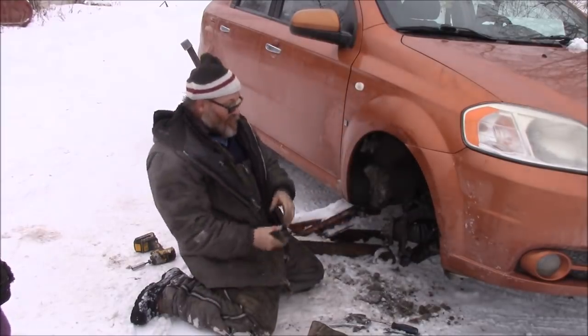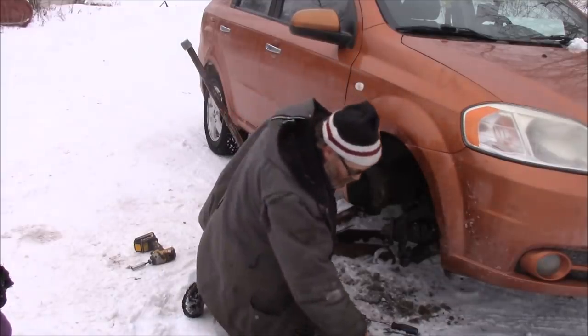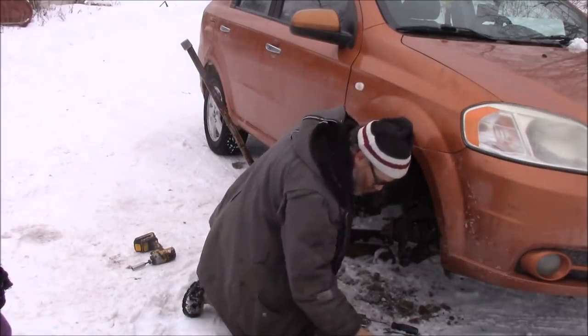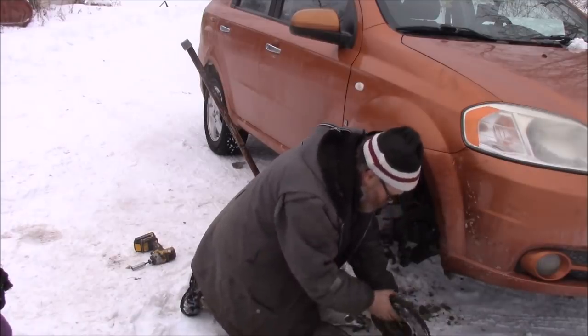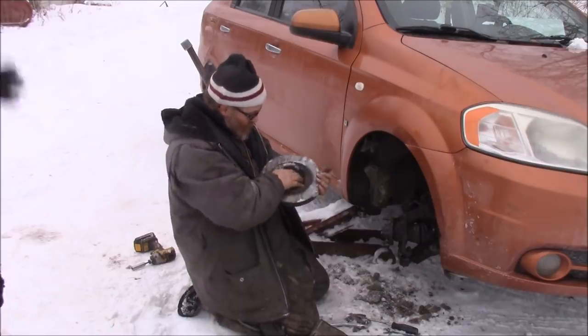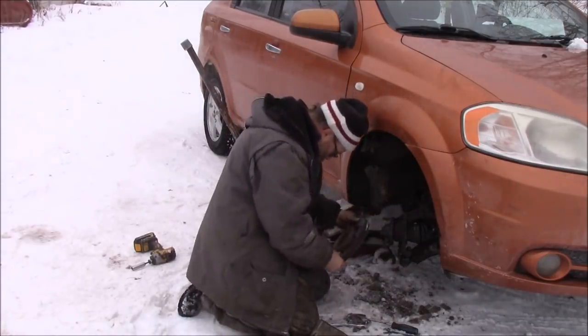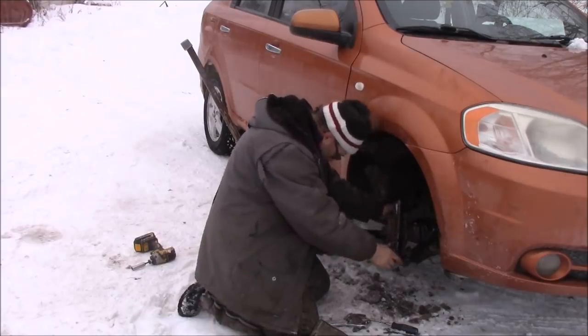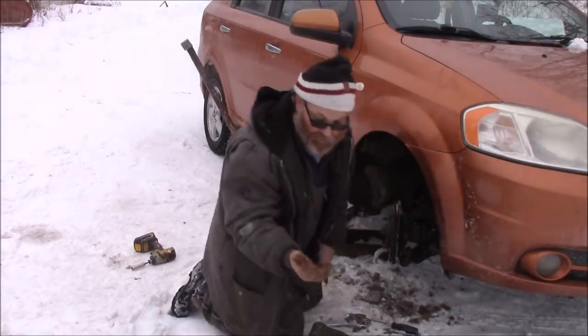What takes wheel bearings out is going in and out of that driveway this winter. That's what happened to it. And I should have known that. I shouldn't have been driving in and out of that muddy driveway, because that's the one thing that destroys wheel bearings quickly. Make sure there's no snow in there because these bolt on with these little Phillips head screws.